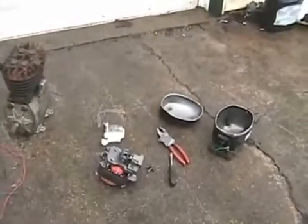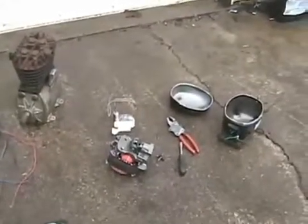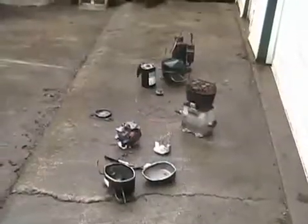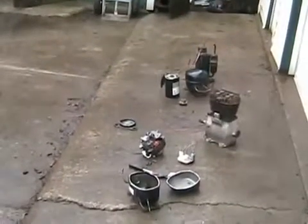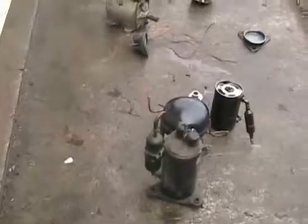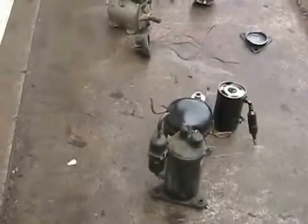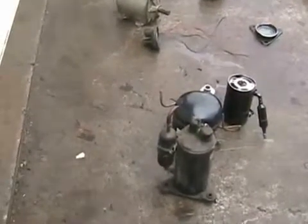If you're into having fish in big tanks, they make a nice quiet and efficient bubbler — they can run all the time and just keep bubbling air into your water. People even use them to aerate ponds to keep trout and stuff in, because trout like a lot more oxygen — that's why they hang out in rapids. Just make sure you always have them in an upright position, because the oil pump always sucks from the bottom. If they're not upright, they soon seize up.